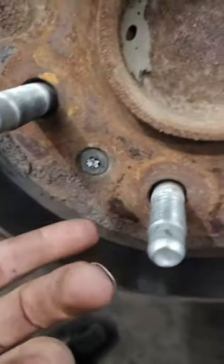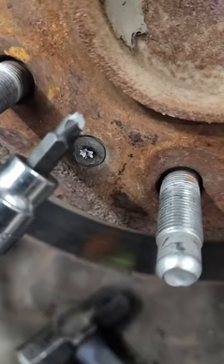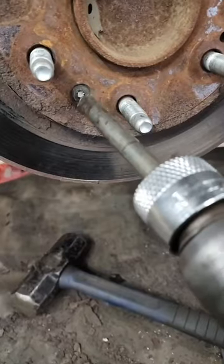Luke is trying to take this rotor off and it's got a set screw in there — broke it off, typical. That bit was on its way out. We're going to show him a different way. I could use these air hammer bits but you've all seen that before, so I'm going to show him a different method — we'll use this and knock this out.